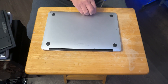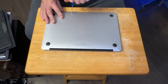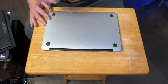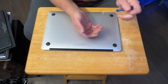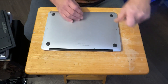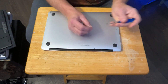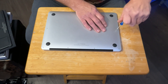This battery does not need any kind of tape — it's just screwed in place. Apple actually should have kept with that sort of system in all their laptops; it would have made life so much simpler. When they switched over to that bonding tape, a lot of times it breaks and you risk damaging the cells on the way out. If you damage a lithium polymer cell, or even lithium ion, they will catch fire — and with lithium polymer, that is not a fire you can easily put out. You don't want to puncture them.